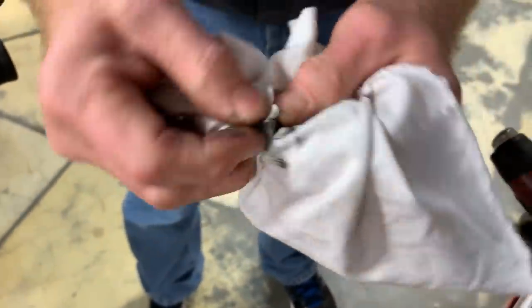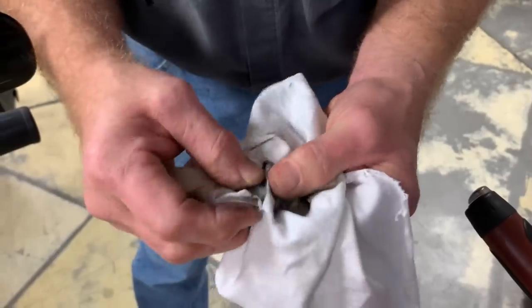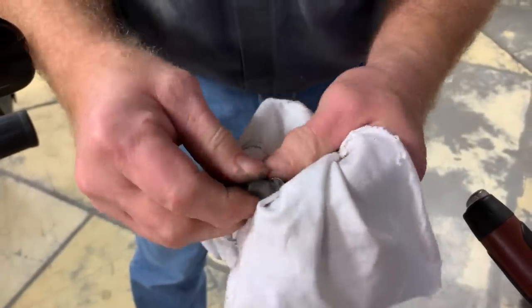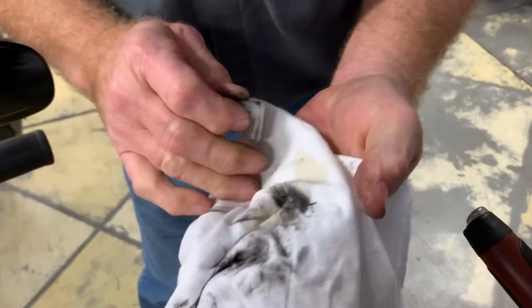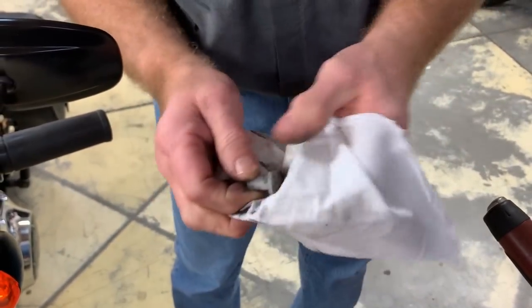All this has gummed up from spraying oil in, combined with mud and dirt from riding and having a good time. All you're doing when you're just spraying is adding a little more lubricant and making that a lapping compound that really wears your part out.